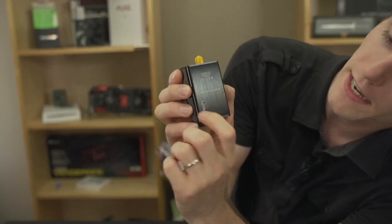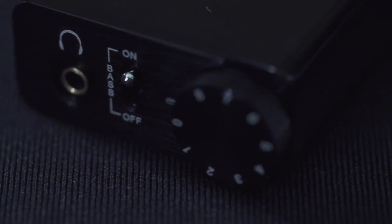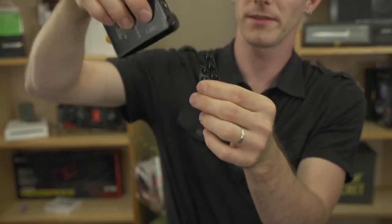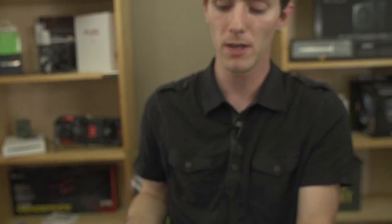On the bottom there's a low or high gain switch. This is basically for headphones that are lower or higher impedance — you want to turn the gain up if you have high impedance headphones. The E10 can handle up to 300-ohm headphones, and down to around 16-ohm headphones, so 16 to 300 ohms. The last thing included is eight little rubber feet, so you can place them however you want — on this side, or that side, or all eight at once.